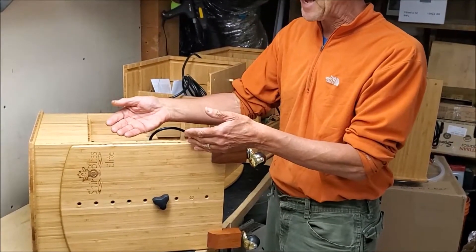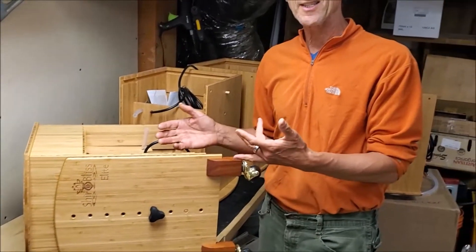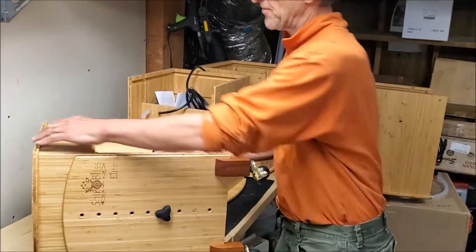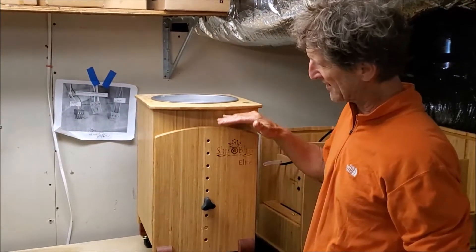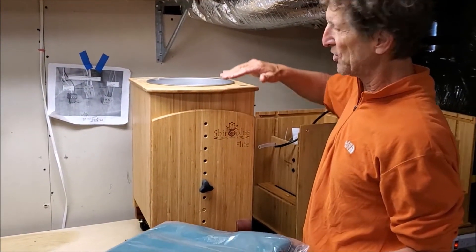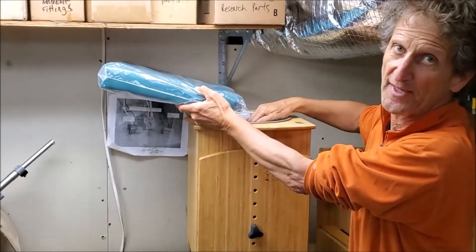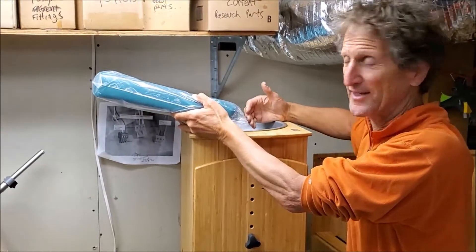Notice that this is on its back — that's a really nice way to do it. But if there's oil on the machine and you put it on its back, it can leak oil. So there's another way to do this, which I'll show you in a second. The whole point of adjusting this leg height is to get the bowl either higher or lower, and what we're trying to do is minimize the drop of the oil from the Shiro pillow into the bowl, so there's less splashing and less noise.